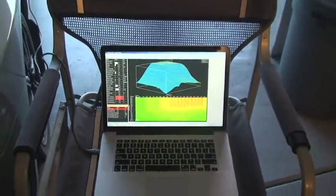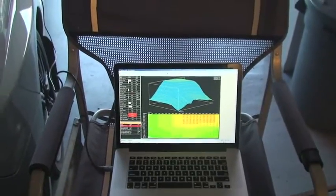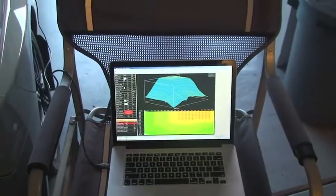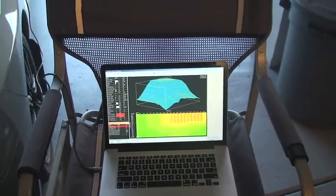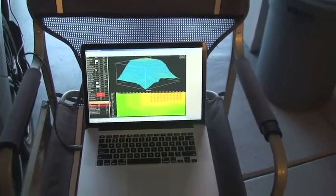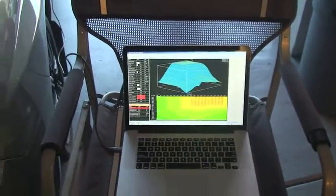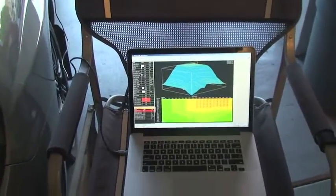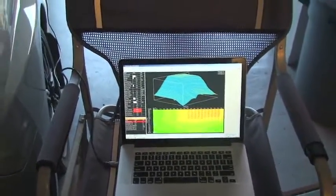I'm going to sync the base ignition timing on a 2006 Subaru Impreza WRX STI. The reason for syncing your base ignition timing is to put a sync between the physical ignition timing and the digital ignition timing. This basically just ensures that what your laptop or your ECU reads as the ignition timing is what's really going on inside of the engine.